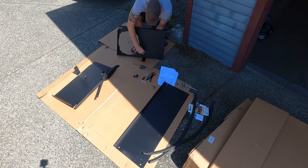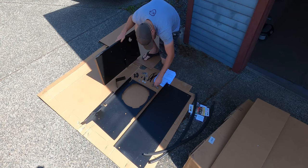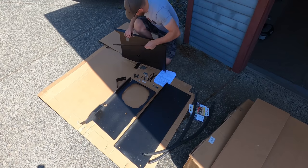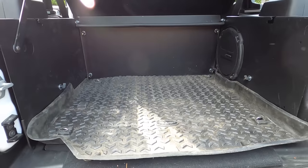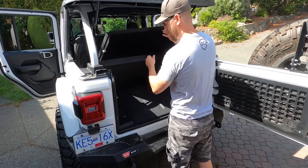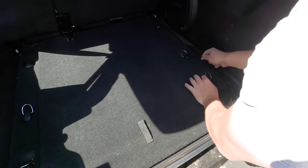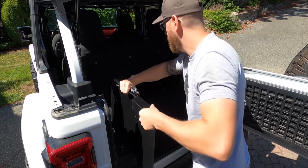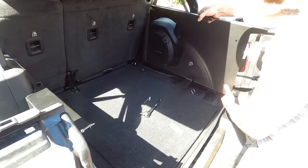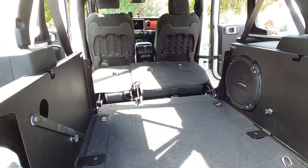I bolted the brackets to each side panel of the security enclosure. I also bolted on a support arm, which is a new feature for the JLs that my JK doesn't have — it allows the lid to be held up when you want to open it and get into the cargo area. Then I unbolted the two middle tie-down anchors in the cargo area of my Wrangler and reused those bolt holes to bolt down the two brackets that hold the side panels. Next, I used thumb screws to connect the rear panel, which goes right behind the rear seats.